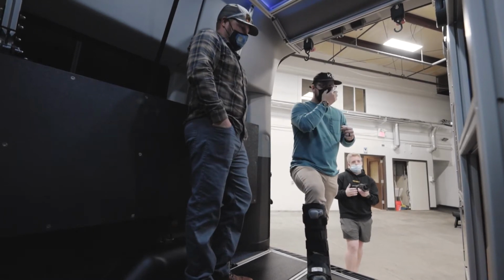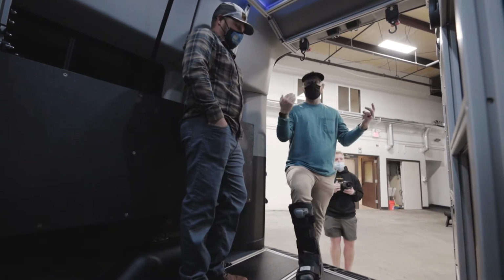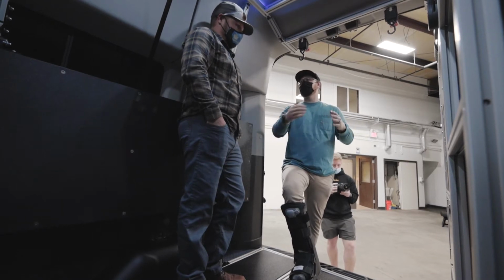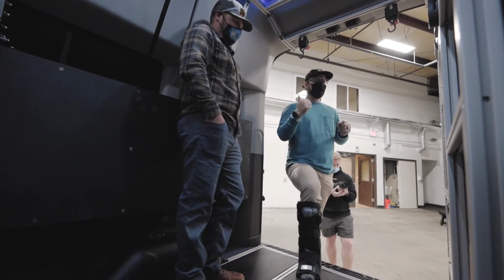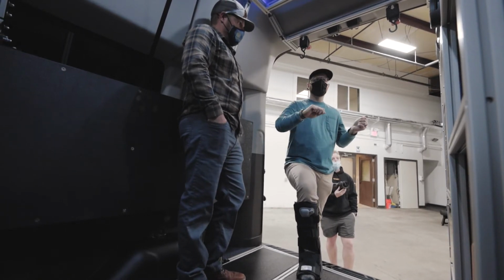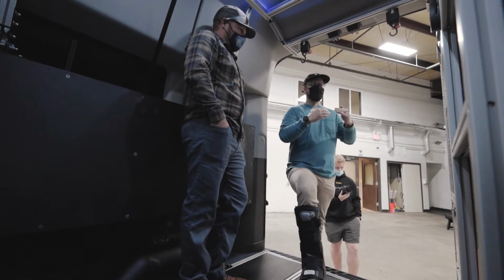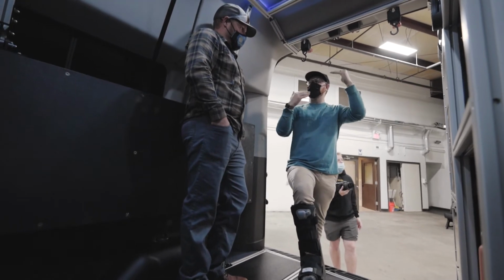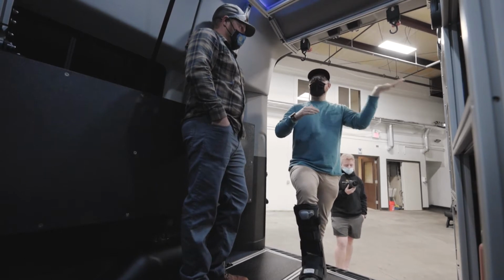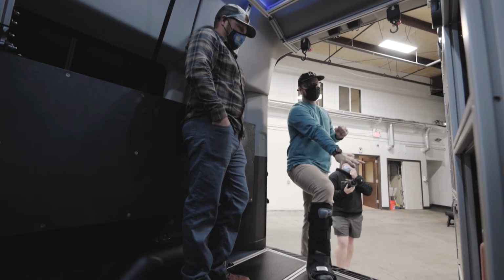So regardless of whether you're charging from solar, shore power, or the vehicle, it's just deciding when we're charging and then charging the other battery system for you. Most notably, you'll see this when you are starting your vehicle. About 30 seconds after that initial start, when the car battery is above a certain voltage, usually in the 14s when we're starting, you'll hear a click. Now that relay closes, connecting the two systems, and the entire time you're driving, this system is charging.